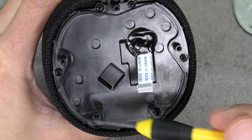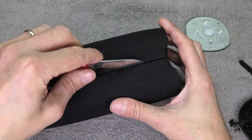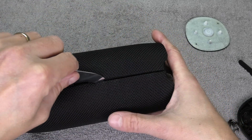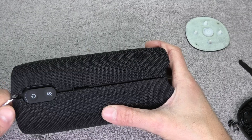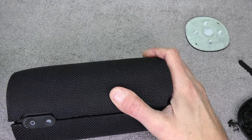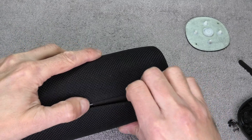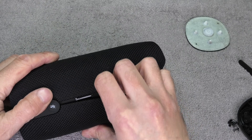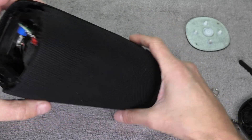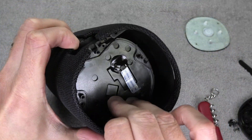On this cover that we see here, there's another couple of screws — four more screws that we can now remove. The next step is to remove this fabric cover. I'm going to pry in between here, and you should hear a couple of loud pops — that's a good sign. That detaches the cover from the speaker. Work your way around and then eventually you can just open this up and spread it apart, then push the speaker through and out.